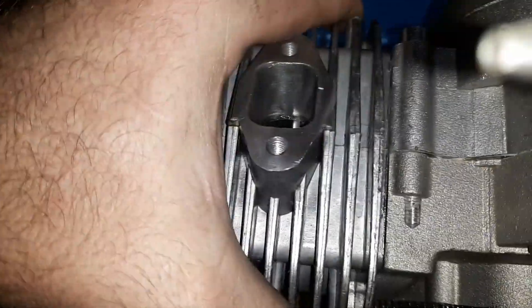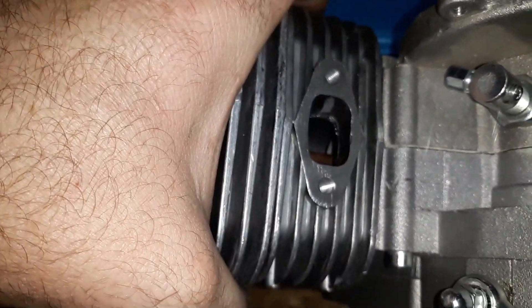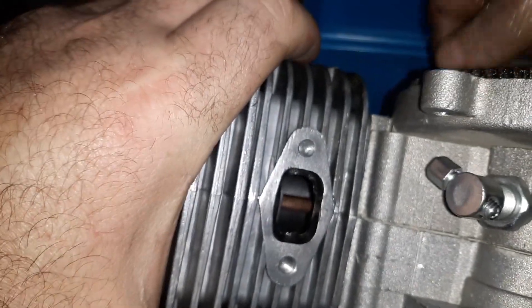On the upstroke, because this is all done wrong, you can see that — that's called cross-talk of a port. Right now the crankcase would be exposed out the exhaust port. I don't have the gaskets on — they're 1.6 — but that gap down in there is actually 2.3 millimeters, so even with the gaskets there would still be an opening. That's really bad and could actually jam the piston too.